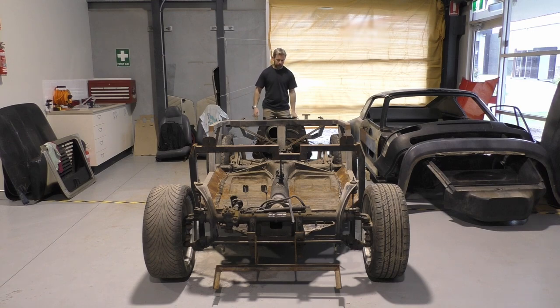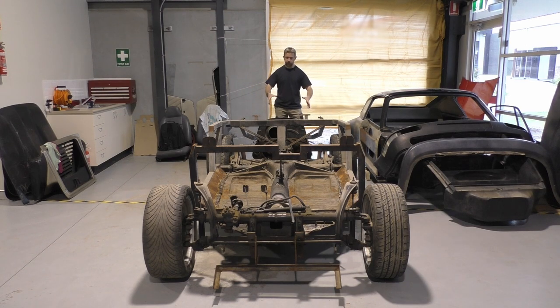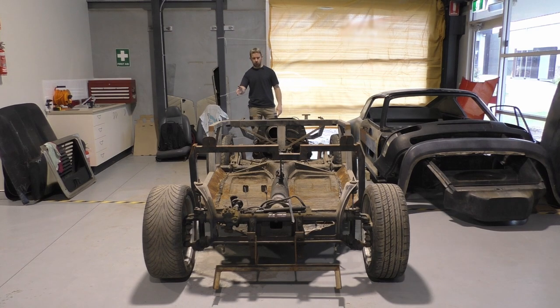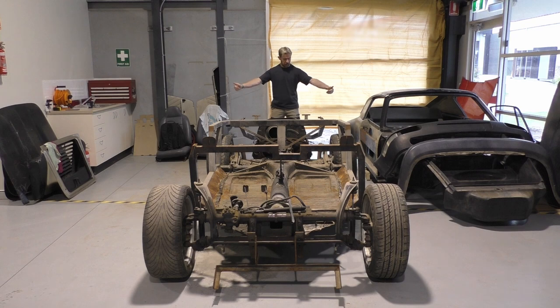The other problem, which will be sorted anyway, there is something wrong with the geometry back here. I have yet to determine if it's the wheel or something to do with the suspension, but there's a bit of toe-out, and this one is perfectly fine. There is no adjustment for toe-out in the back of these cars, which means something's bent. If I put a tape measure from either end of the tyre facing inwards to the valve cover, there is a fair bit of a gap.